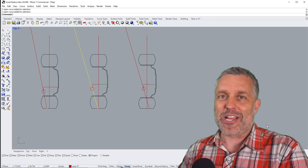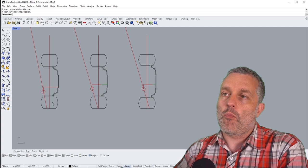There's another drawback to increasing steering axis: the wheels might be perfectly vertical going straight, but as the wheel turns it actually leans outward. With a five-degree increase, in a very sharp turn with the wheel spun all the way around, that wheel is already going to be leaned over five more degrees than stock. This can put stress on the whole wheel attachment system — this aluminum spacer, for instance. So if I'm doing tight turns, I'll do them very slowly. I'm not taking this on a racetrack anytime soon.